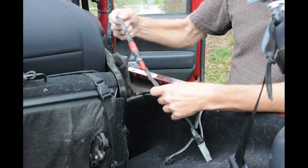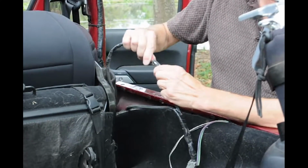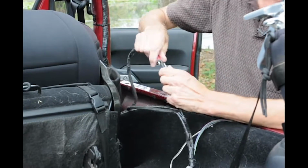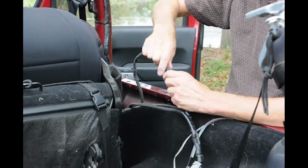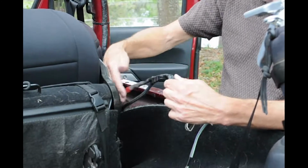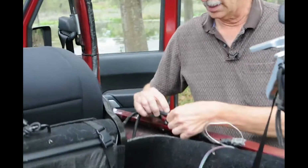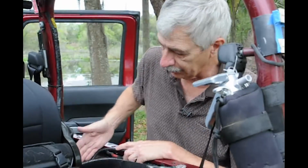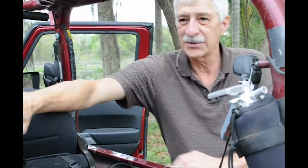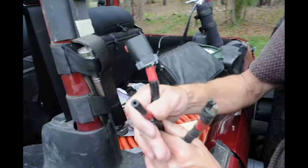This one is my new cable. It unconnects like this. Buy those at any auto store, trailer connections. I put a red on each side just so I can see where it comes apart. This one goes to your upper. Then I came up close and I used the little blue Scotch connects, and I put 2 wires in, got a new piece of this cable cover, took it down to the floorboard, ran it across under the carpet and everything, and over to the other side, right to this corner, where these connect to the hardtop.